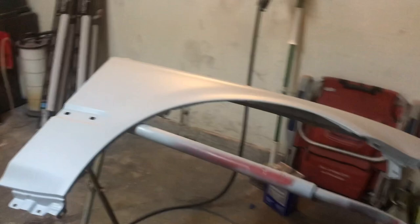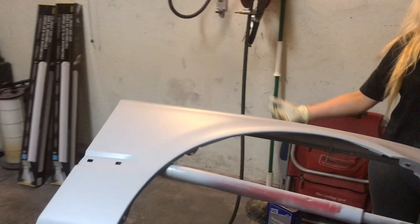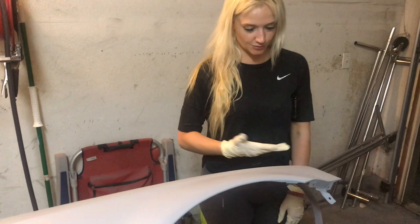And then when you spray it, you want to dry each coat, blow it with air, each coat dry. If it's this cold, you can use a hair dryer. Okay, so if it's cold, you use a hair dryer. But always try not to spray directly into it because you're pushing the moisture back in. You want to spray to the side and push the moisture to the side. Okay, gotcha.